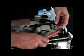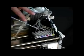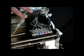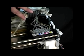We talked about the printhead carriage. Underneath the printhead harness — the ink harness that actually brings ink into the printhead — we've got a little hood that it mounts to and tape that holds that hood in place. If we peel that up, we can swing this little hood up and see down inside. These little white things are the dampers. The dampers are basically a filter — they filter out any impurities in the ink as well as any air bubbles. There's a little pocket of air at the top, so any air bubbles go up there instead of going down. If you get enough air in a line, it could drain the damper and you will lose prime in the printhead for that color.